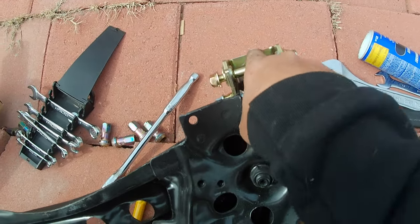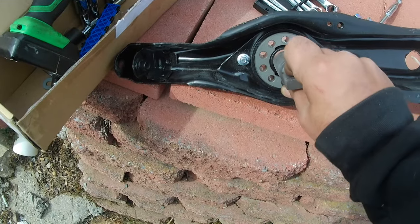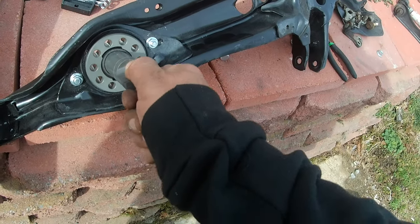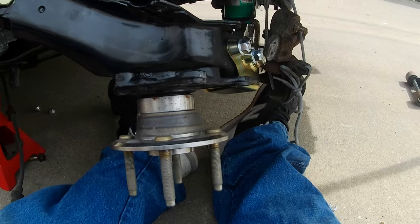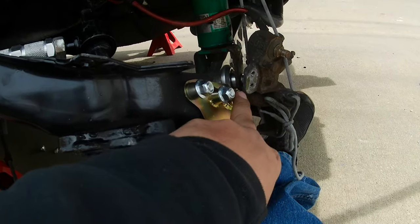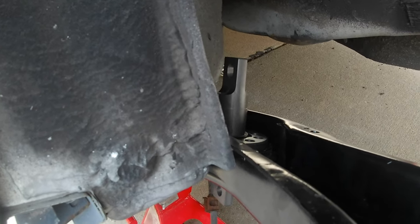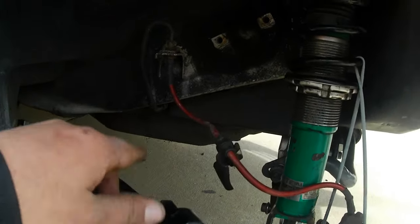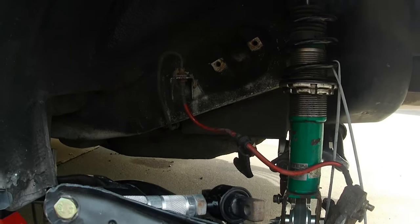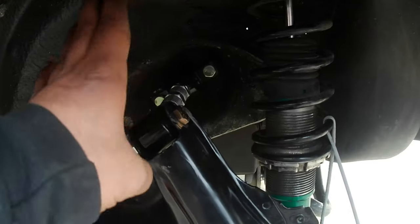This is the trailing arm with the home development roll center correction and the ASR revolver. I'll slide this in once it's underneath the car so I can line the holes up. Getting this back on is a little bit of a pain to do by yourself, but I got the lower control arm bolt in and tapped in the ASR trailing arm mount. Since the trailing arm is twisted I'm going to try to get this camber kit bolted in up here. I'm going to put some anti-seize on the bolts so I don't have problems in the future.